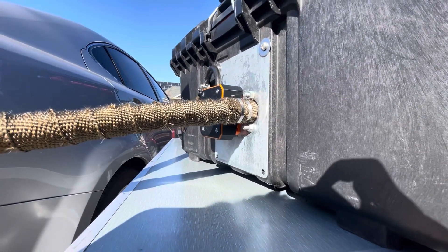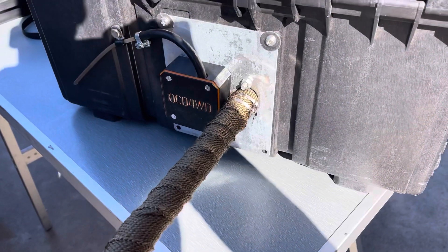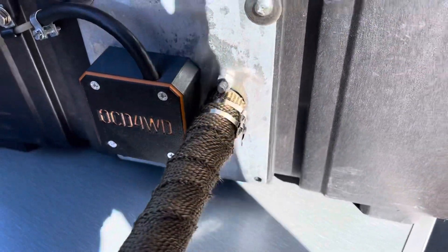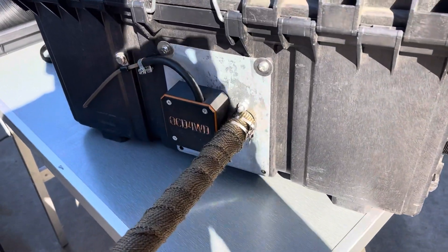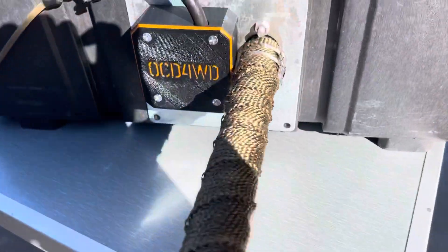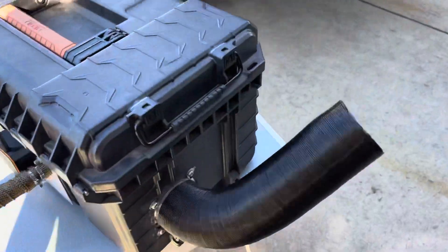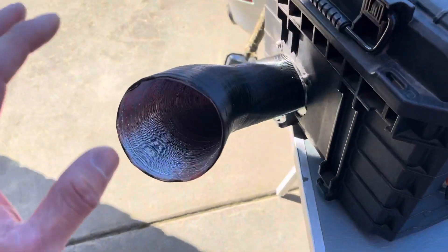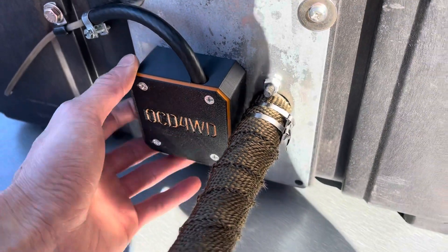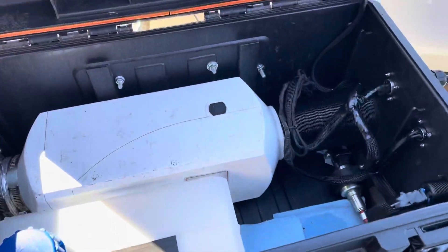It's burning off the oils or fumes on the wrap. After about 10 minutes the wrap's not smoking and the plastic seems to be holding up. It's 71 degrees out today so I'm not sure how hard the heater is running or how much heat it's putting on the exhaust pipe - I may not know until I take it out on a trip and run it overnight. The intake box isn't drawing in any exhaust; the pipe isn't smoking at all. I do run kerosene, and the system is working like it's supposed to.